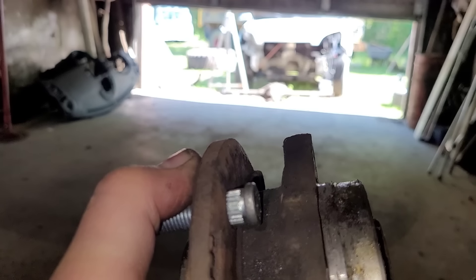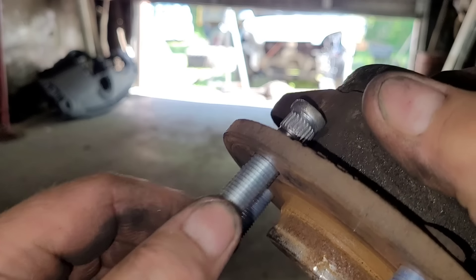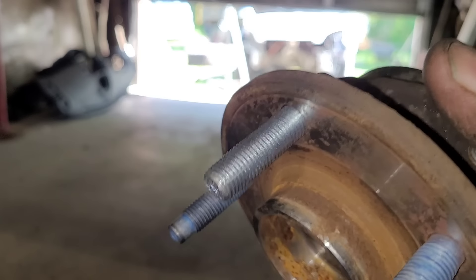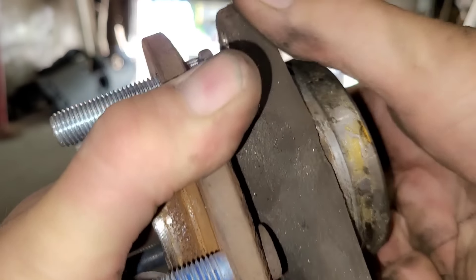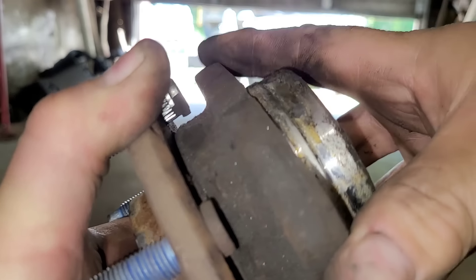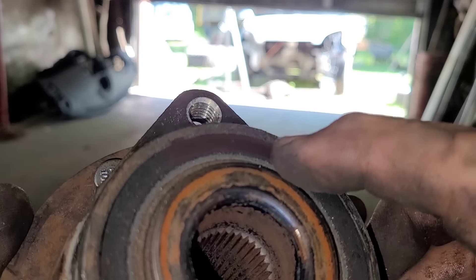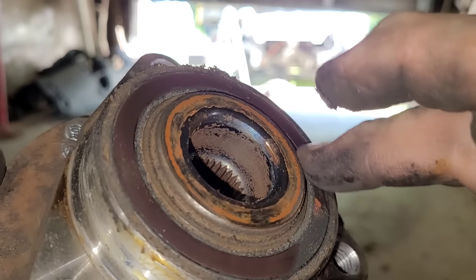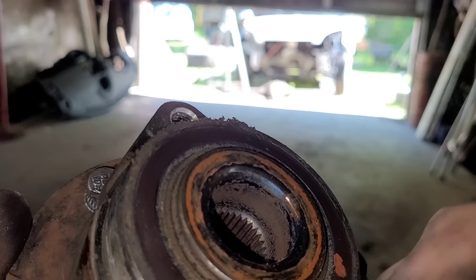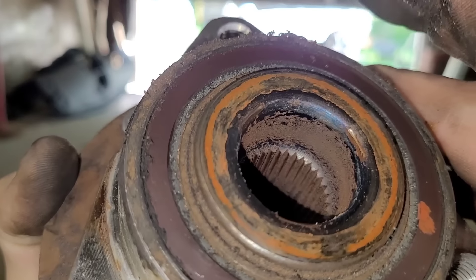What I'm going to do is bolt this back in place and then show you how to actually install the stud. This is actually a rarity where you've got to take the whole thing apart like this. Had this bearing felt anything peculiar, I would be replacing it — but it feels perfectly fine, nice and smooth, good snugness. Also, if you notice the back of the bearing here — see this surface? That's actually a magnetic window, and that is for the ABS sensor. As the wheel is turning, the ABS sensor reads off of that.